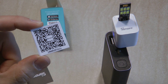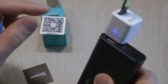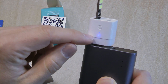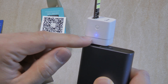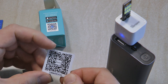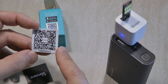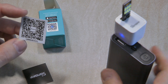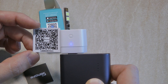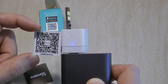This is my first Sonoff product that has to be paired using a QR code. I didn't read the instructions initially, so I was clicking the button for a long time to get into pairing mode. I could get the flashing pattern activated but nothing happened when I tried quick pairing. Once I read the instructions, I noticed the QR code — you need to pair it in the eWeLink app by clicking the plus button, selecting QR code pairing, and it pairs right away. It's important to mention: don't discard the box before you start pairing the device.